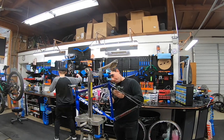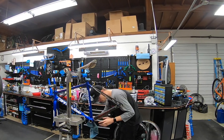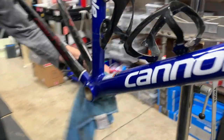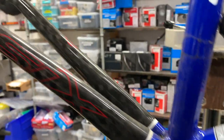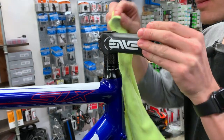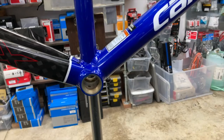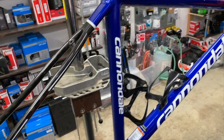So we've got the bike fully stripped. Now it's time to clean everything up, start with a clean slate, and then start assembling the bike again. Right now I'm just cleaning out the bottom bracket. Then I'll go to cleaning the entire frame and re-greasing everything — all the threads and contact areas. We're basically at the point now where we're clean and detailed, the bottom bracket shell has been cleaned out, and we've inspected the frame for any cracks or damage.